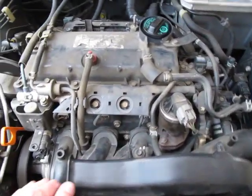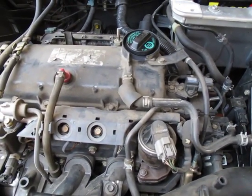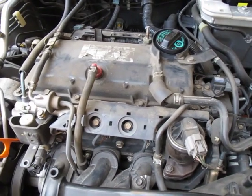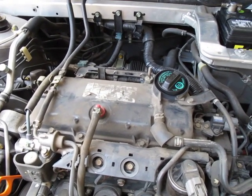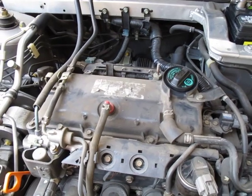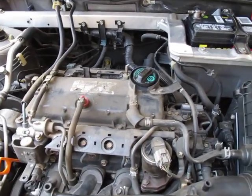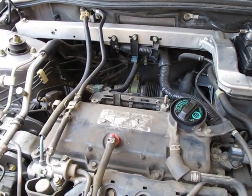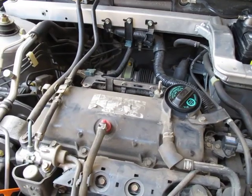The other way I'm thinking about vaporizing the gasoline is using an ultrasonic transducer or ultrasonic humidifier - same thing. This will vaporize the gasoline without any heat; it uses ultrasonic waves. You can do a search on Google for ultrasonic humidifier - there are many out there, industrial sizes and household sizes, and you can even just buy the ultrasonic transducer itself and build your own. These are made for vaporizing water but they also can vaporize gasoline with no problem. They use very low power and vaporize at a very fine mist, which is what we want.